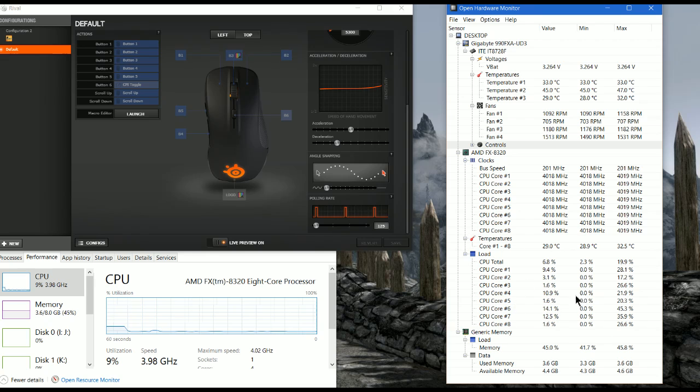I said, "Well, I like to play games like CSGO and other first-person shooters. I'm not competitive, but I do like to have an advantage when I can. And the advantage is, say I'm playing at 1,000 hertz, which means it takes 1 millisecond from the time I move my hand on the table for the mouse to move on the screen, versus, say, someone who's playing at 250 hertz with their mouse's physical limitations. That means it takes them 4 milliseconds. It means that I can react exactly 3 milliseconds faster than that person.